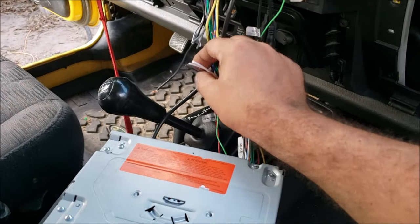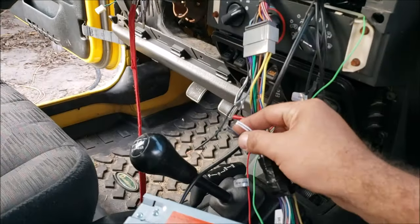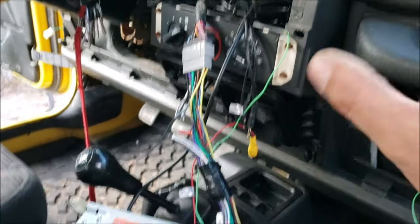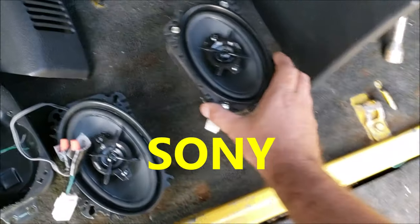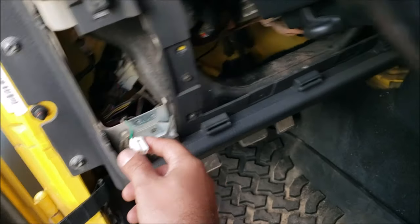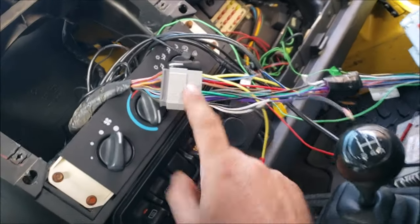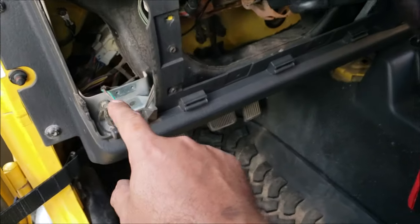Then what you're going to do is start cutting speakers. I noticed the front speakers weren't working, so I just cut the four wires and it instantly cleared it — the radio is working now. I'm assuming the previous owner was having problems with the front speakers, so he bought new ones, which are pretty nice. But the problem is going to be in this wire from right here to right here. I should have done one at a time, but I was really frustrated.